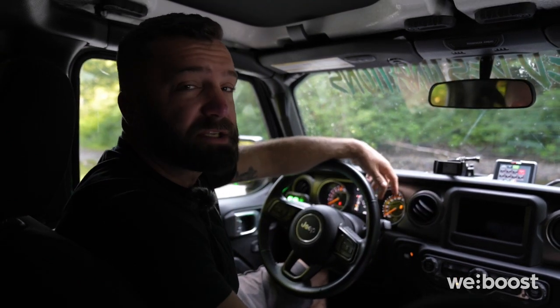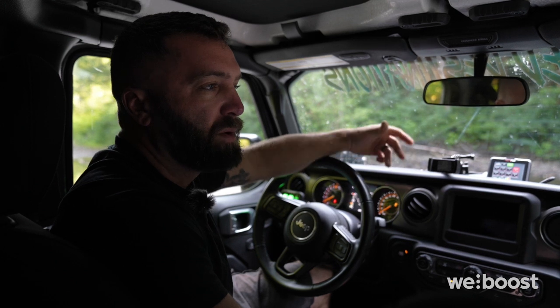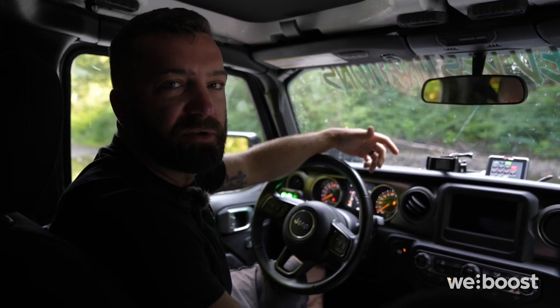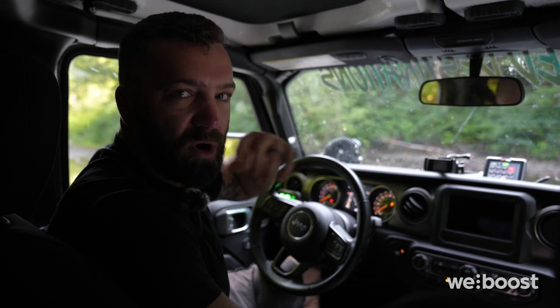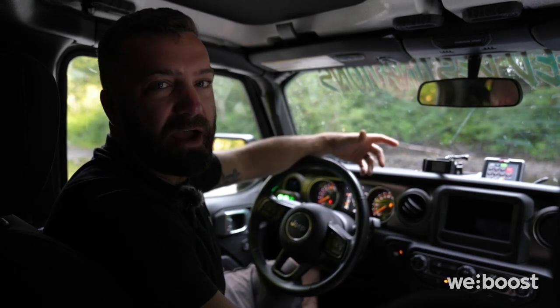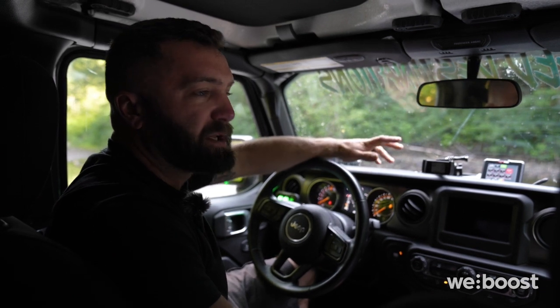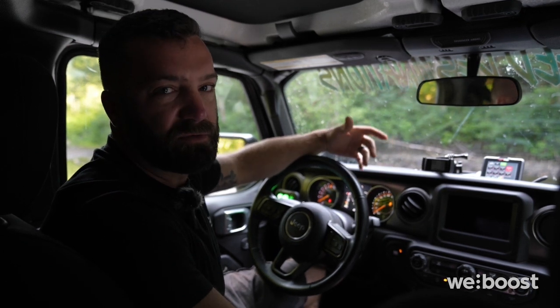So as you saw today, guys, this is a booster. There does need to be some service. It can't make service out of thin air. But in a spot like this where we had 1, maybe 2 bars of service, we were able to get 3 or 4 bars of LTE. We weren't able to complete calls with the system not on. We were able to complete calls with it on, and I was able to load a 1.5 hour long YouTube film with it on. Although it is a booster and it does have the limitations of there needing to be service, this could be a huge factor for anybody who regularly finds themselves in remote areas.